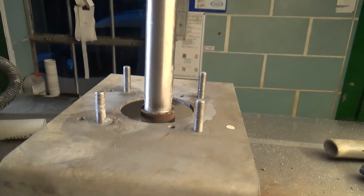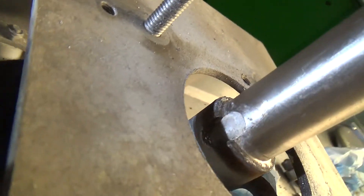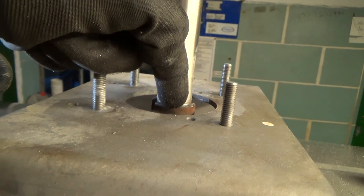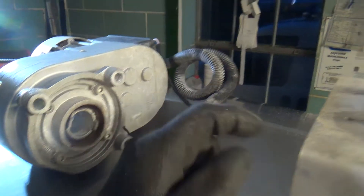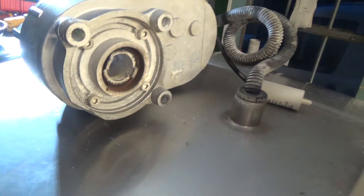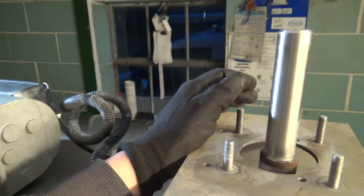Okay, the thread's all cleaned up. When you put the paddle on, it's got two little drive dogs on the output of the agitator and they need to go down into those cutouts. If you're not careful, you can bolt them up with those little bits sitting on top and it will work for a bit, then they'll slide around, they'll get to that section and the bolt will come loose. Usually when you put these back together, you can just about see the top of it through that hole. It might be worth checking with a mirror underneath, looking up to see it's located properly. I usually put it on there, spin it around by hand, push up and you'll feel it go up a bit, then do the bolt up quick with the other hand.